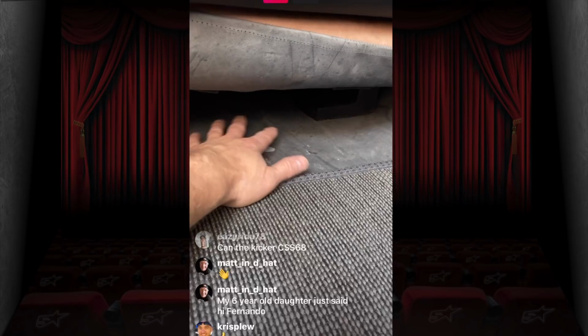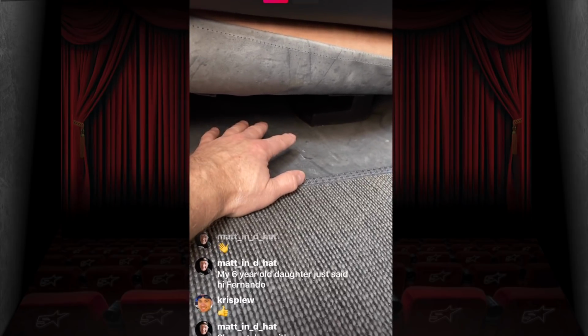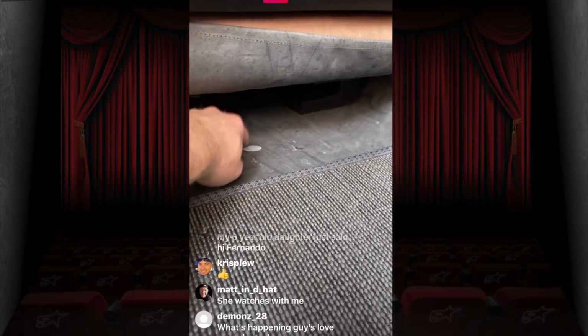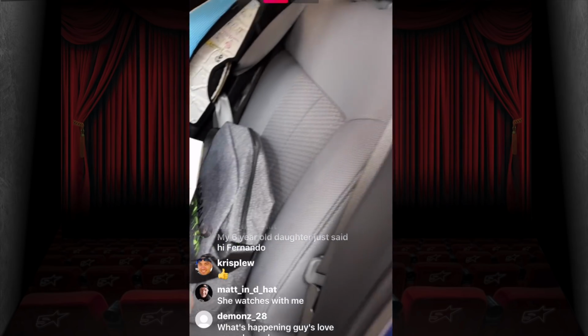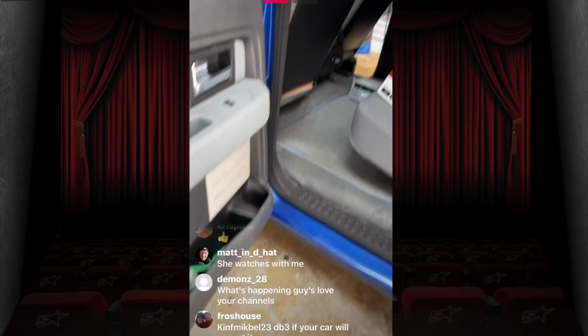So having the panel there, the panel is then attached to the car. The amp is attached to the panel. It's serviceable. It's removable. It looks nice, as opposed to just me putting 2 drywall screws through the frame of the car and then running all the wire. So the idea behind the panel, and just like if we go behind the seat here, is for the amplifier to mount to.